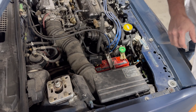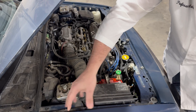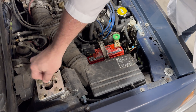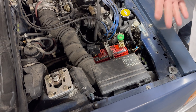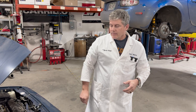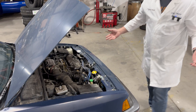That gives quite a bit of adjustment over where the suspension goes, but this is all adjustment you can do on the Miata using the suspension adjusters already there. One downside is that because these front struts have to move, they also have to rotate — as the steering turns, the strut top has to allow the strut to rotate. So there have to be bearings in there, and those tend to be high-wear items. Luckily in the Miata, we can literally use solid pieces of steel in some cases. Moving the top of the shock around on a Miata doesn't affect the alignment at all — that's one reason why you don't use camber plates on a Miata.